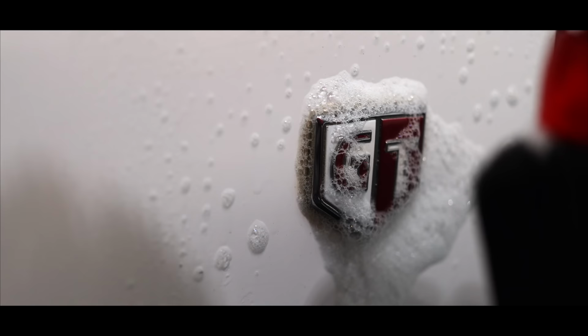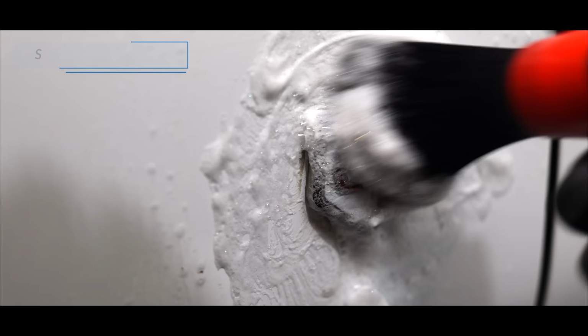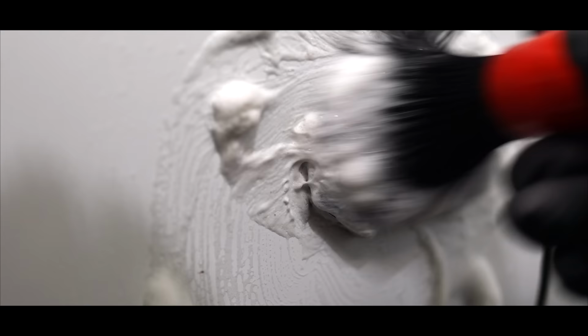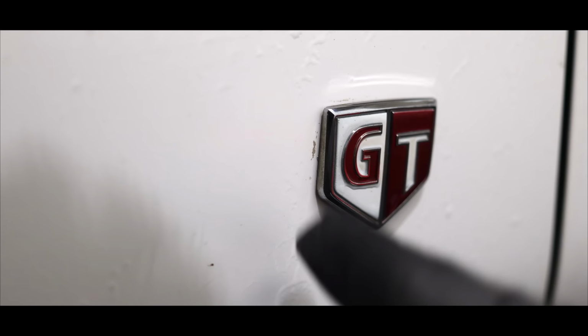Spray some of the chemical directly onto a detailing brush and then use it to agitate the area, just using moderate pressure to encourage that baked-on scum to loosen, lift, and come off. After brushing for 30 seconds or so, rinse the area down to remove the lifted dirt and to better evaluate your progress. I can see around this badge that I've removed about 80% of that original contamination.